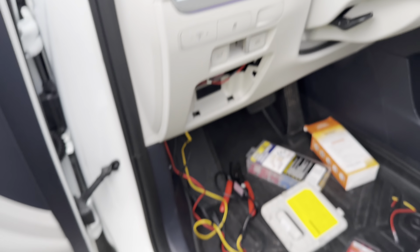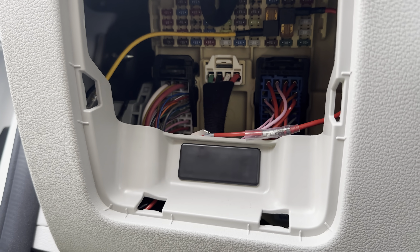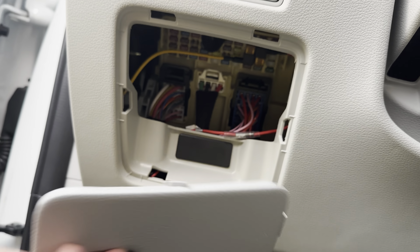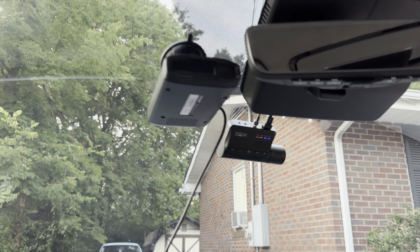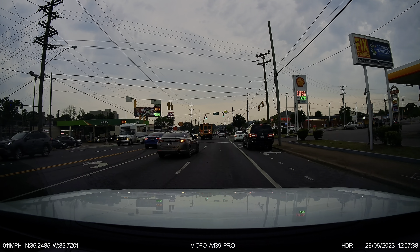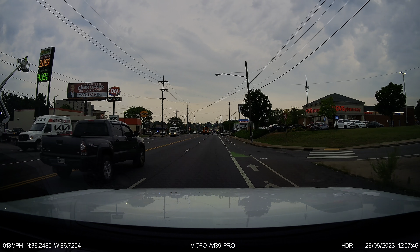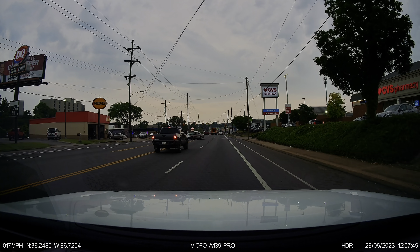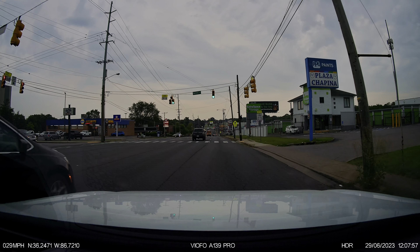That's your voltage adjuster — I have it set for 12 volts, so when the car battery drops to 12 volts it'll stop feeding energy to the dash cam so I have enough juice to start the car. I have my radar detector there too — I'll probably make a review on that later. Don't forget to do your ground — conveniently there's a little screw right next to the fuse box; go ahead and sandwich your ground right there. After that you're good to go. Put everything back together — all the cables are hidden, clean installation. I love the way it came out. All I've got to do now is record idiots like this one on the road. Looks like this camera is going to pay off fairly soon. Hit like, subscribe, and I'll be uploading more videos like this. Thanks for watching!